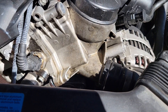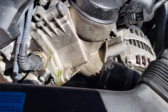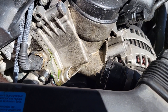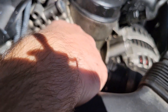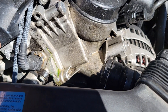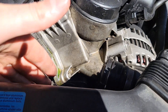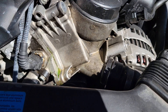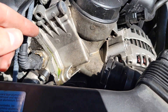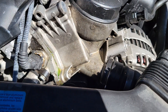If you're using metric it's also very comparable to a size 8. You'll notice that coolant is already starting to come out, so this is when you're going to want to have your bucket handy. There is that bottom plastic skid plate underneath — you can remove that if you want to try and catch it differently, but getting a bucket generally where it's going to be flowing out is going to help you out.